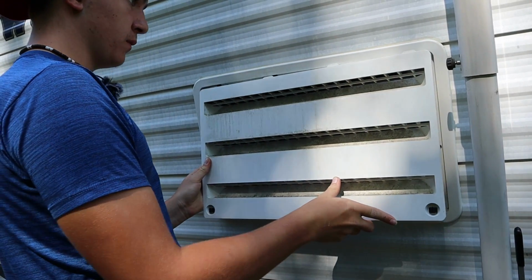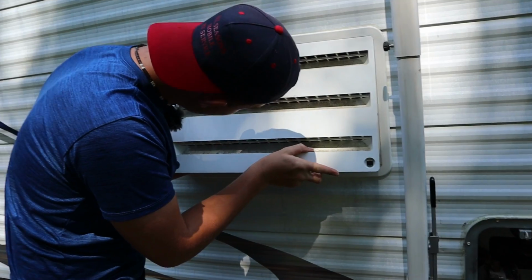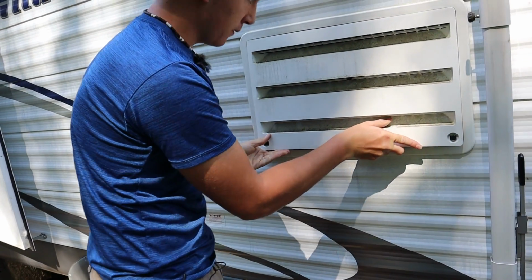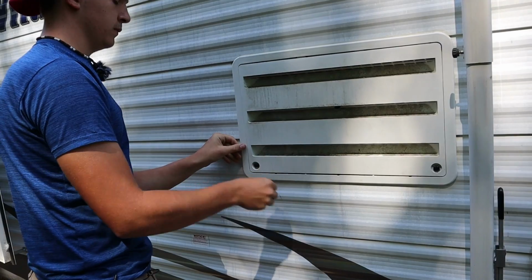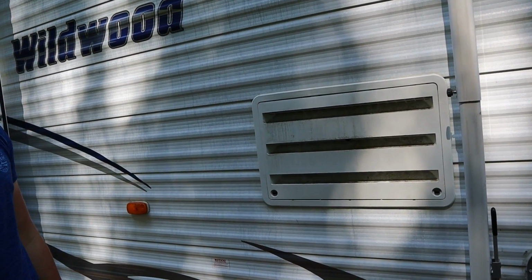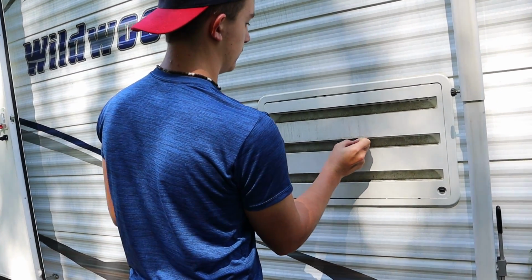The refrigerator appears to work. It will be a while before we know if it's gonna cool. See, yeah, there you go. The manufacturers say 24 hours to let a refrigerator run to see if it's going to cool. So I think the customer's going to hang around today, and he should know here in the next few hours if it's going to cool good.